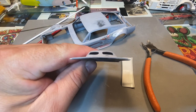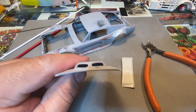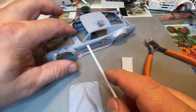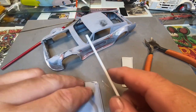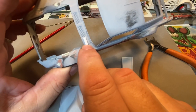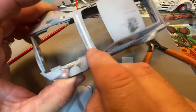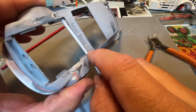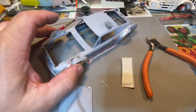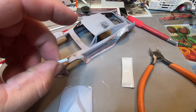Voila - just like that. I'll try to use these outside corner areas to mount the new hinge. If I bury this piece underneath the cowl, you can get by with using the full length of the tube, but a lot of times I just cut it short so you don't have the bulkiness of a tube across the inside of your cowl. If for whatever reason you open up the hood and can see it, that way it just minimizes the clutter underneath the cowl area or inside the trunk. All I do is roll my Exacto blade straight down on top of it, roll it back and forth, and it snips the cuts pretty easily and clean.